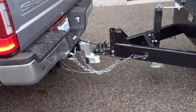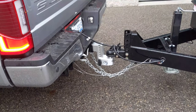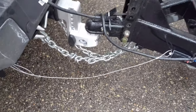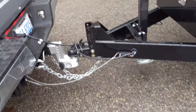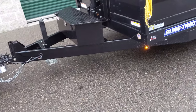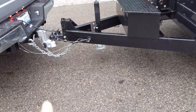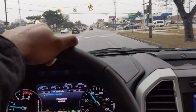These WeighSafe hitches can get worn out because of the soft aluminum — the pin that holds the ball is in soft aluminum. So if you have a WeighSafe hitch it's probably a good idea to keep the ball greased real good, and if it gets loose go ahead and switch out that section. If you're gonna be doing a lot of hardcore heavy-duty work, like unloading a bobcat, it might be a good idea to use this scale to find your tongue weight, set up the trailer, then put it in the cab and use a different hitch that doesn't have a scale and doesn't have moving parts.